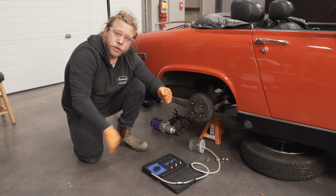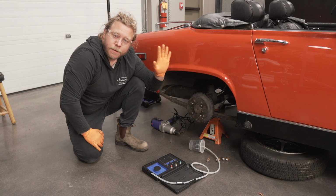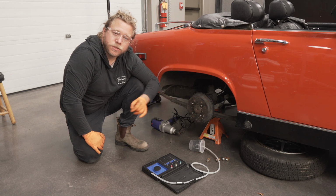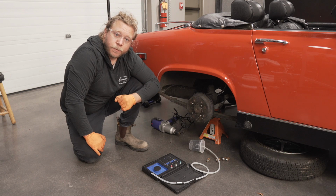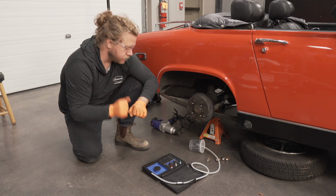Attach the right wrench, attach the hose, crack it. Now, when you go inside and pump the pedal, it's going to be pushing air and a little bit of liquid to purge the line, and that's how you bleed the brake. So let me attach this all together, and then we'll hop in the car and start pumping the brakes.